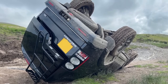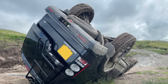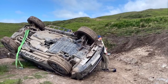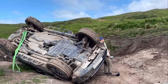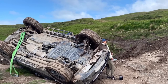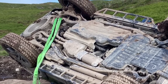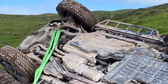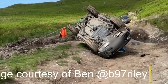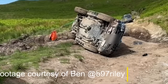The first job was to find a suitable place to rig a strap on the underside of the disco. We chose the rear suspension arm and were able to get a strap around the rearmost leg of the arm to try and pull the back end of the disco around while also lifting it up. As the disco came round, the rock sliders were actually digging into the bank and acting as a pivot point.